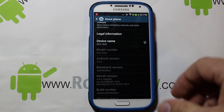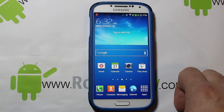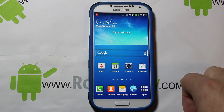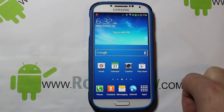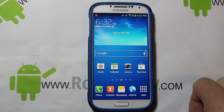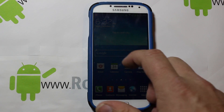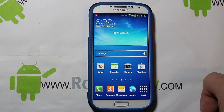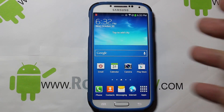I have a video on it and all that. Something I'd recommend is to get to stock system before you do this update. For example, if you have SafeStrap installed you're either going to want to ODIN and restore and re-root, or what I've done — which is even easier — is just run the whole root video again if you have SafeStrap installed. It'll reflash the system, re-root your device, and remove SafeStrap so you don't have to worry about it messing up your install.